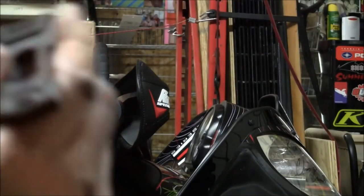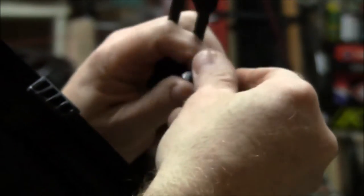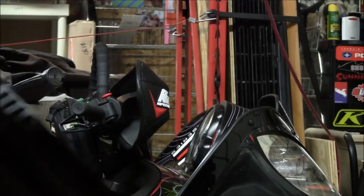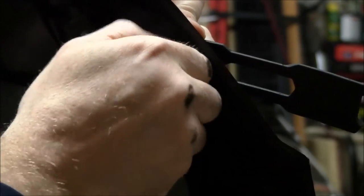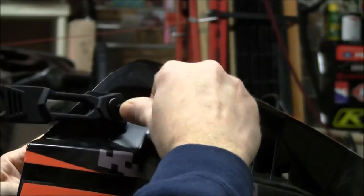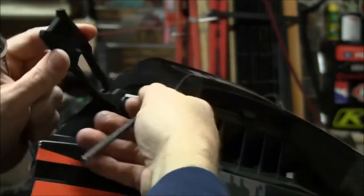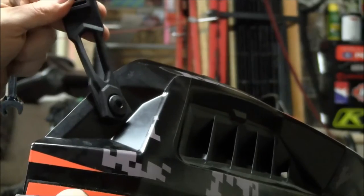So you're gonna take a short strap. You're gonna take one of these, just a shoulder. Insert that piece there, which goes through the back side of the panel. Put the washer and the nut on. I usually tighten these up snug until you get it exactly where you want it. Just leave it loose like this so that once you get your angle, you can tighten it up, so the strap's not tight down here, but it needs to latch up here.